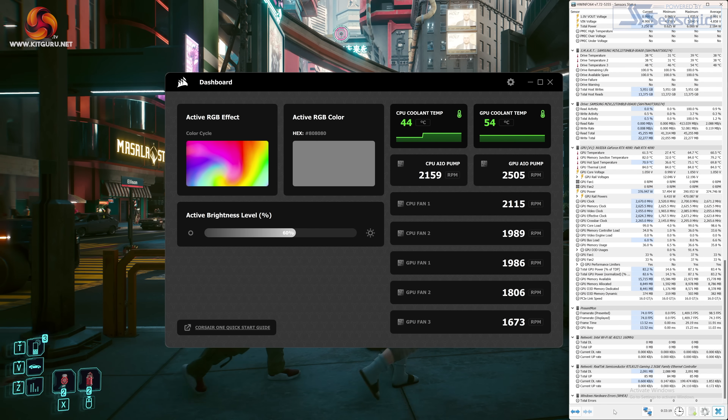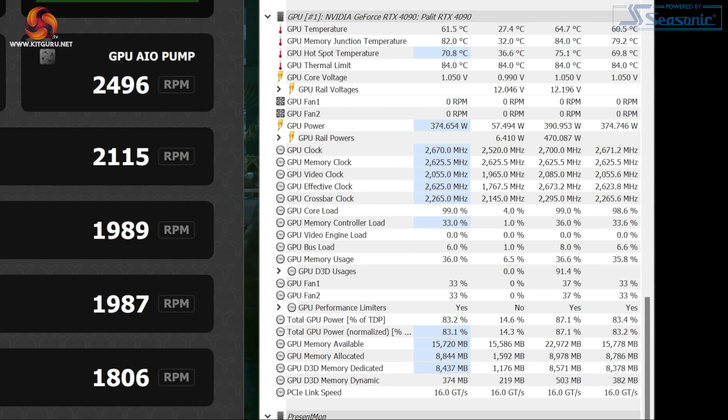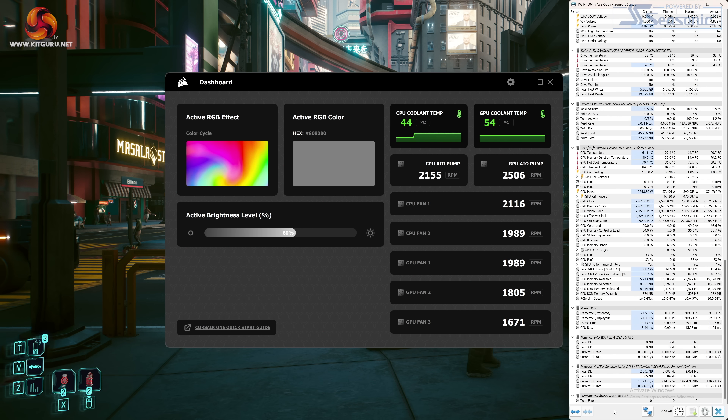As for the GPU, this is really no problem. Package power is showing a touch under 380 watts, but a GPU temperature of around 62°C and a hotspot that's about 10 degrees higher is a very solid result for a 4090, and the same goes for the memory thermals of around 82 degrees. You can also see that those system fans are close to 2000 RPM and from a 30-centimeter distance that sounds a bit like this.